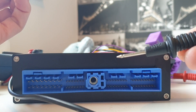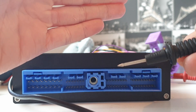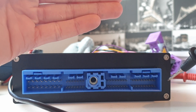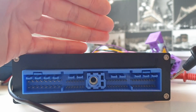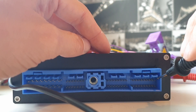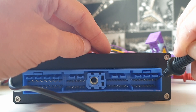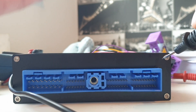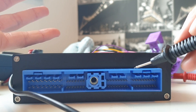What I've done is taken the red connector on my multimeter and put that into the ECU ground pin on the black EMU black connector, and I'm going to use my pin reference chart to see which pins are the ECU ground pins on my OEM connector. The sheet says pins 39 and 48 are my grounds — that one and that one. We do a test and as we can hear there is continuity there. I'm now going to do this for all of the pins — I'll speed this section up so I won't bore you.